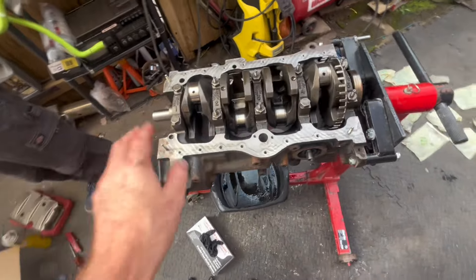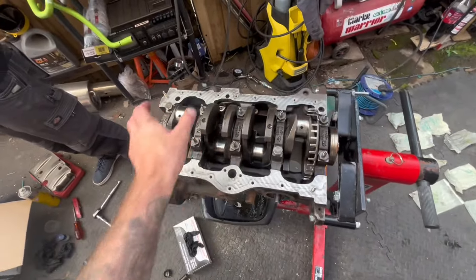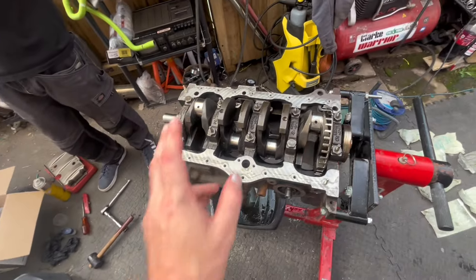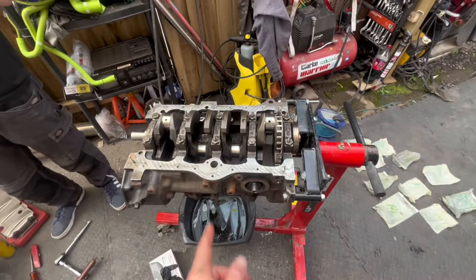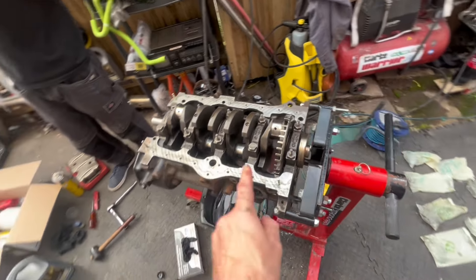James is going to torque the settings up and we crank these down. We need to pick up the baffle plate and get that on. The bottom end is pretty much done. Then obviously we've got the ends and stuff, we've got the cam — flick around, start building the top end up, get pistons and rods and all that kind of stuff. We are starting to get somewhere.